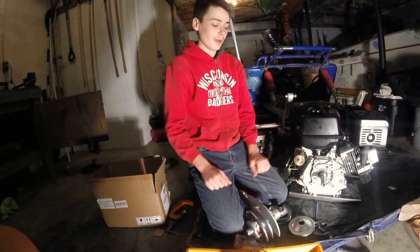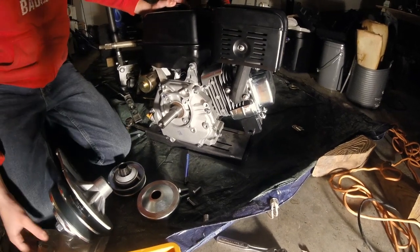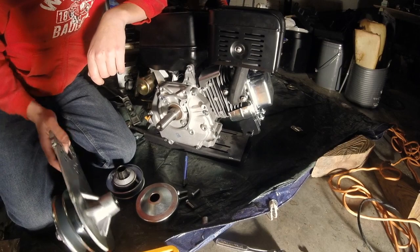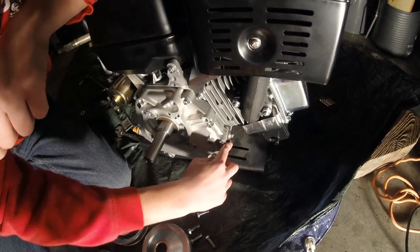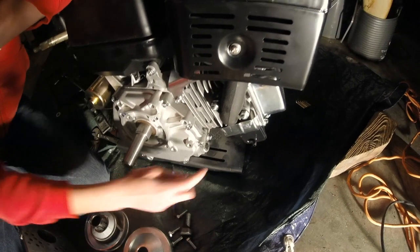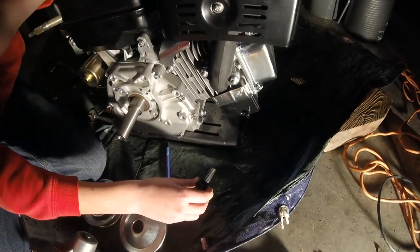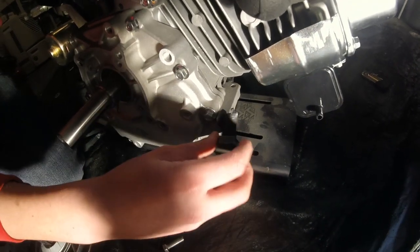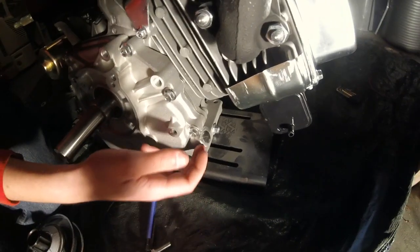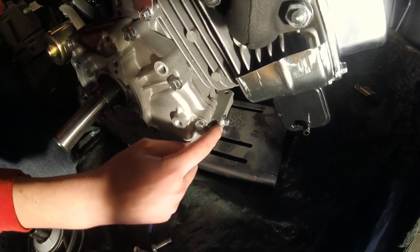This will work with one small modification that you have to do, and that is with the oil plug right here. In order for this torque converter to mount on the shaft and line up, you have to take about an eighth of an inch off of the oil plug. To do that, I permanently sealed it off — I took the dipstick out and bought an 18-millimeter coarse thread bolt, which is a rare size but you can find it. I put the bolt in the hole with a lot of Teflon tape and some thread-locking compound, cranked it down, then cut the bolt off flush. You can actually see the center of the bolt right there, and this gives me the extra room I need to mount the torque converter.